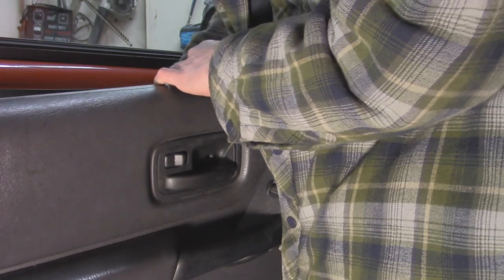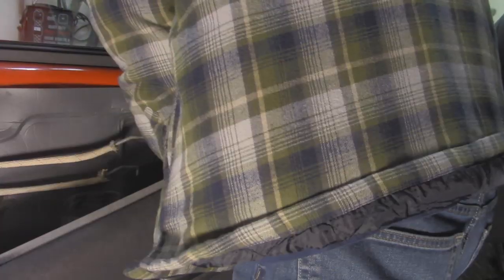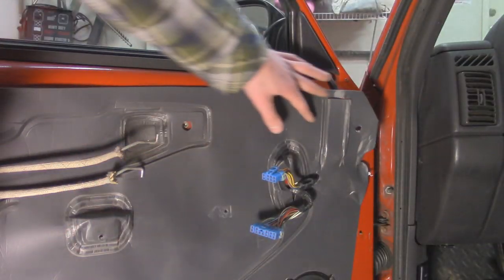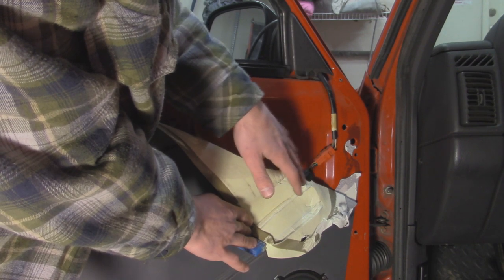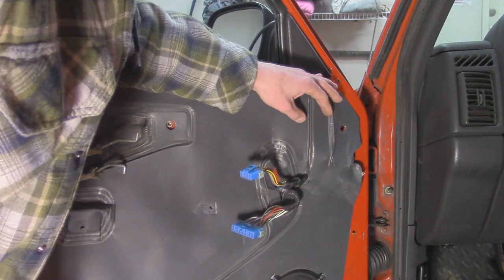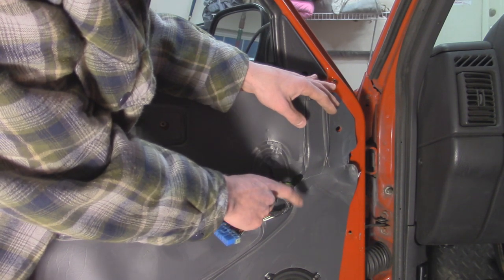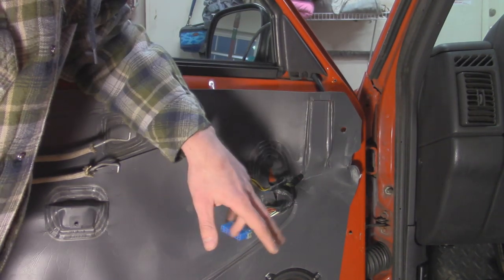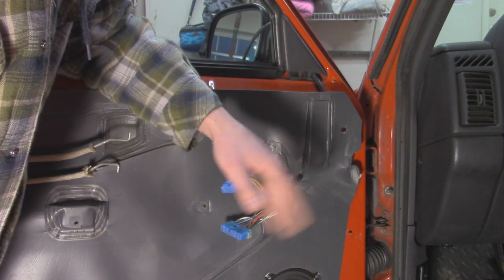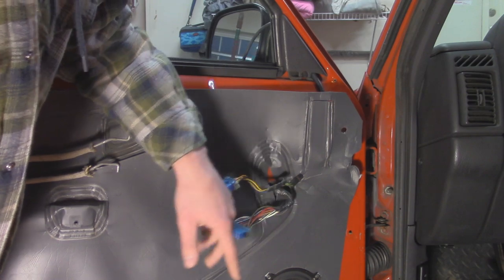Once you get it loose, lift up so it comes out of the top window seal. Then we've got our two door rods — you're going to have to pop off those safety clips. We've also got two electrical connectors on the back if you have power windows and doors. Once the panel is off, peeling away this plastic you can see where it's indented in the door frame, and that's where we're going to want to install our tweeter so it has enough room and isn't contacting anything. As far as wiring, all Jeep Cherokees — regardless of whether they had tweeters — actually came with an empty plug right here. All you'd have to do is cut off the plug and wire in your new wires that go to the tweeter.